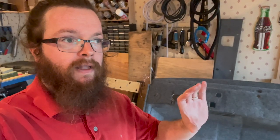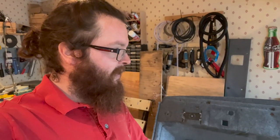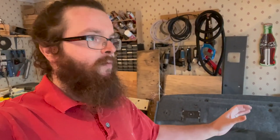With our cab area we do still have the original headliner, but it's a little bit worse for wear and getting the carpet off is going to be difficult. It also weighs quite a lot — it's primarily made of fiberglass, then padded out with sound deadening and wood and all sorts of stuff that's bonded to it on the back. We could reuse this but I don't think it's going to give us the storage solution we wanted at the front. So we're going to try and make our own version using bendy plywood, which should also allow us to add 50mm of insulation in the cab area.